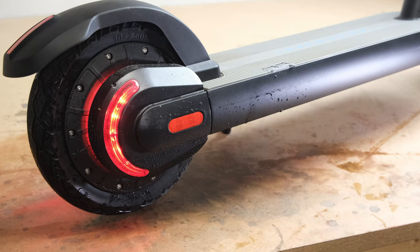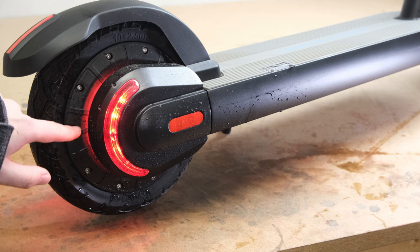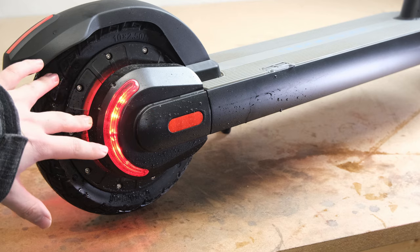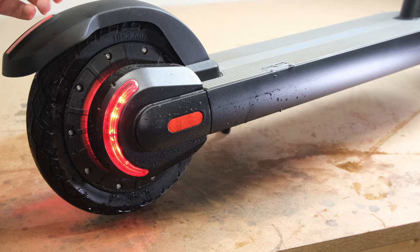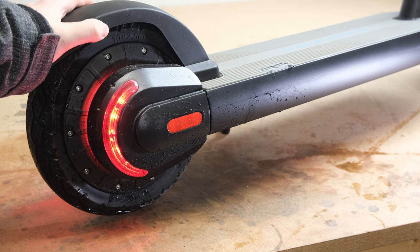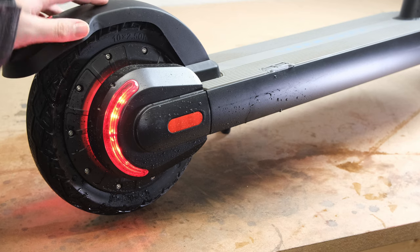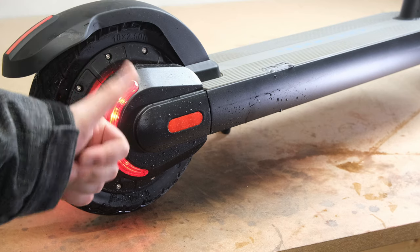Now let's show you the rear wheel — big hub motor in here, I think it's 800 watts. It's a really powerful motor and that's great from a safety standpoint. There is traction control built in so you're not going to spin up the wheel, and because it's so powerful it's really good at going over hills and bridges. Even with my full camera backpack I could still get to the top of the nearest bridge at 21 kilometers an hour. I love the motor — it works really well and it's also not very loud.